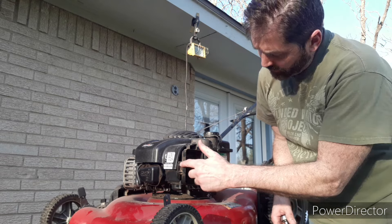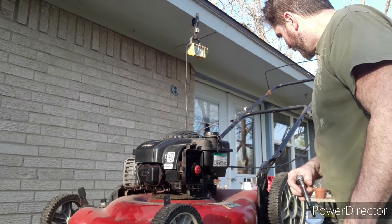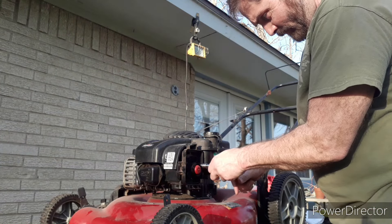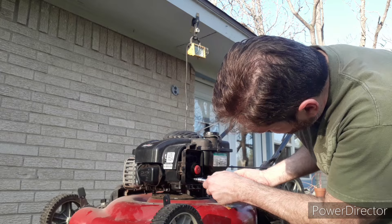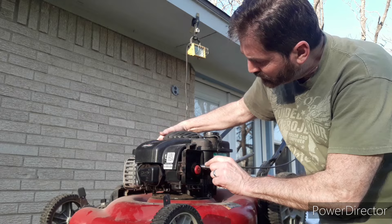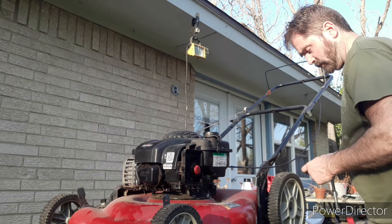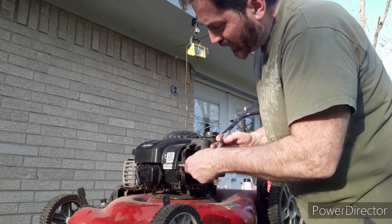This cover for the carburetor is held on by three bolts on the inside — one bolt here, one to the inside. The seven-millimeter ones are outside, or eight-millimeter. Have somewhere to put these so they won't roll away and get in the grass — trust me, you don't want to look for them down there. Correction: one of the bolts on the inside is an eight as well as this one right here.